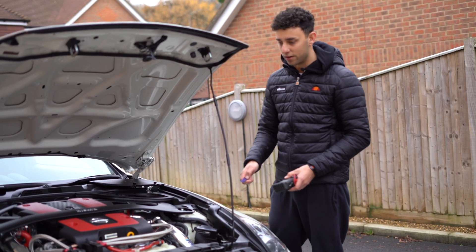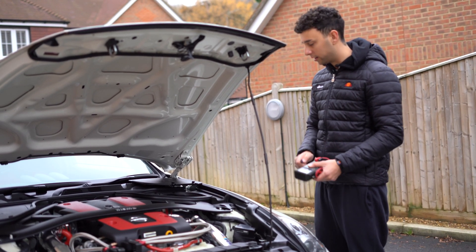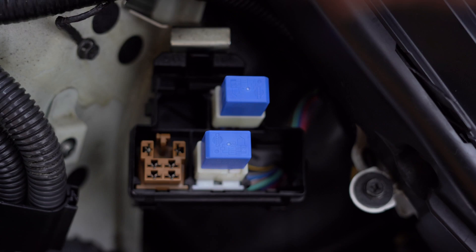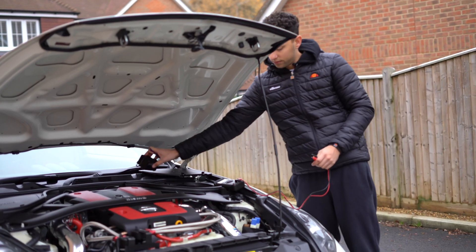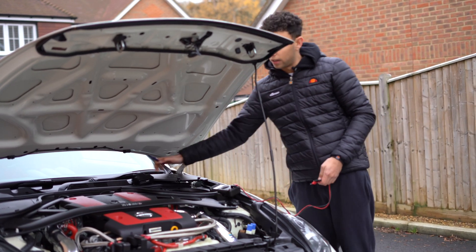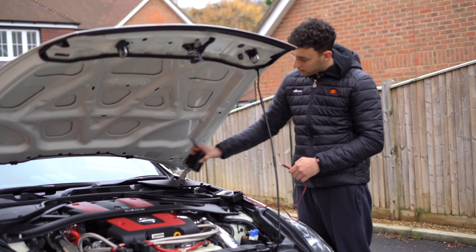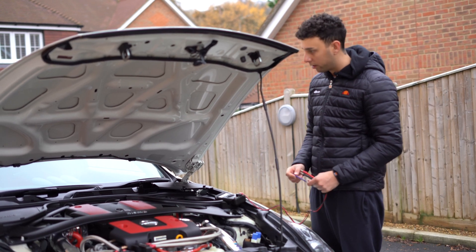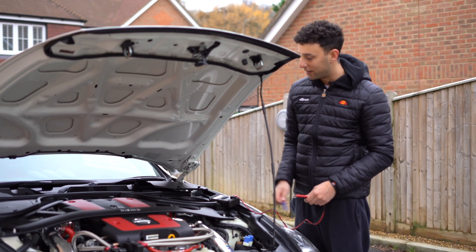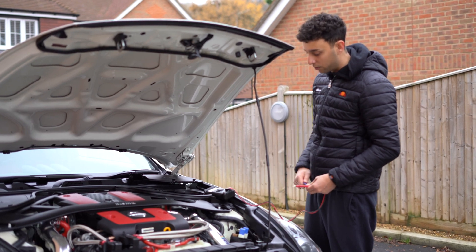We're going to look over the DRL stuff for the front lights. To do that you're going to need your multimeter and your plastic pry tool. There are a few clips on the cover - one back here, one there - and the cover comes off. If your car looks like this, with your battery here and your relay box here, you'll notice the DRL relay because it will say in big letters 'DRL relay'. On American models the battery is probably in a different position.